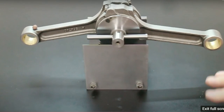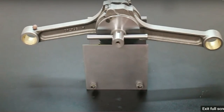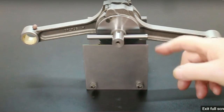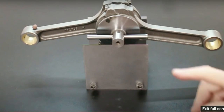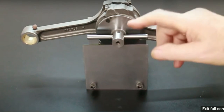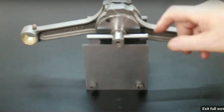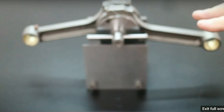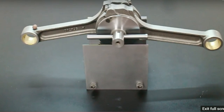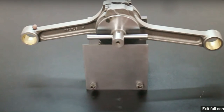Now, if you've got this on a surface plate and you can get both of those level, you can actually see, you get them level with this pin here, how much one of them's out of balance with the other. First off, you put the pin in, find out where the whole lot balances, put a little scribe line on, and then that's the position of the pin. Then you put your rods on, and the idea of having them droop down is that they're stable enough for you to be able to just make minute changes. Anyway, that's how that works.